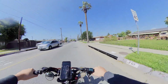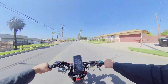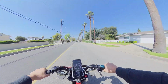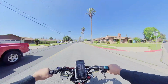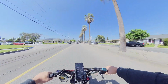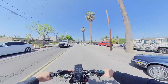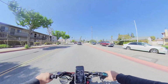Yeah, let's keep going. Let's ride. Let's see how far we can further test this. Hopefully I don't burn my motor and stuff like that. I've been touching it here and there. It's not way too hot. It does get warm because we're pushing about 3,300 watts basically on the stock motor when it's rated for 2,000 watts. So obviously keep that in mind.